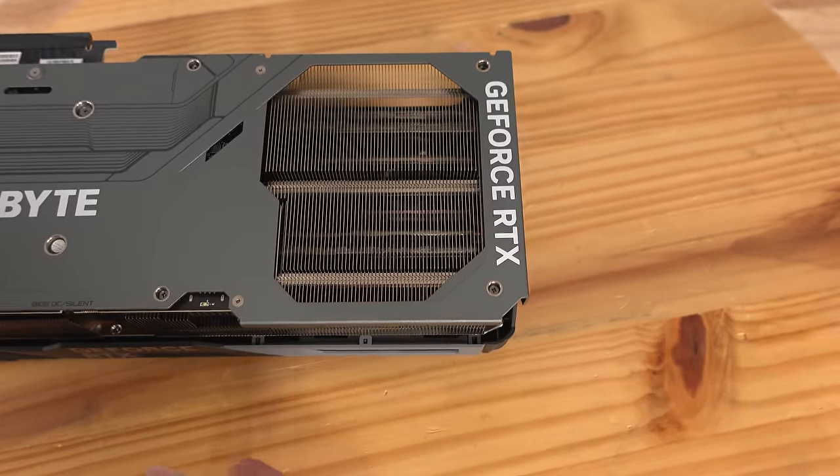While holding the video card, unscrew it from the rear I/O bracket. It's easier to do this with the system lying flat, but I'm demonstrating standing up. With the screws removed, look at the base of the PCIe slot — there's a locking mechanism holding the card in. Keep one hand on the graphics card so it doesn't fall, then push the locking tab in with your other hand while pulling the card out, and remove the video card.